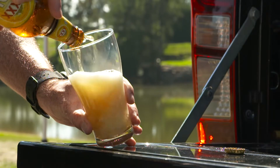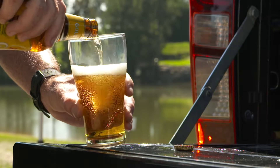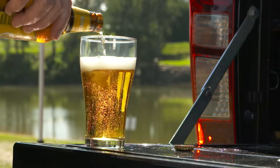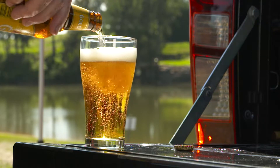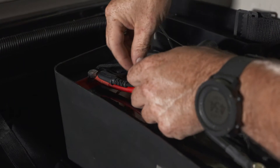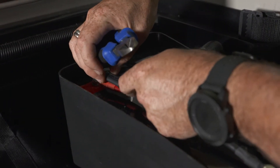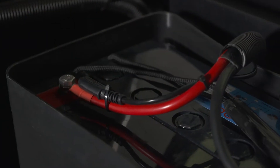Overcharging a battery is like overcooking a roast — once it's too far gone, there's no bringing it back from the dead. The D250SA is a five-stage charger, meaning as it gets close to full, it tapers off the amount of charge going in so it doesn't overload it. It also has a temperature sensor you place on the battery. Should it get too hot, the D250SA will automatically put less voltage in, which stops it from overcharging.